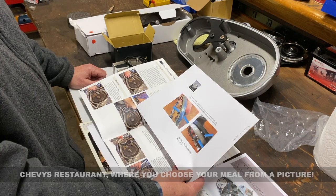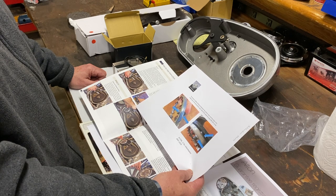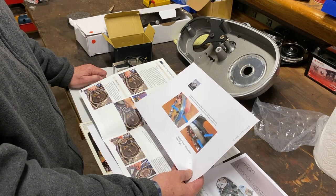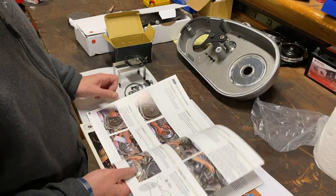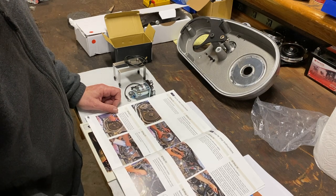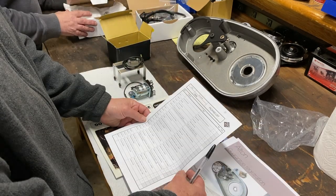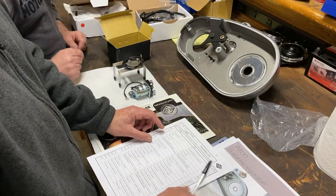There's an addendum — it's about shimming. We've got to make sure we've got clearance between the starter chain and the stator coils, and we may have to fit a washer to ensure clearance. We need to remember to do that. There really isn't too much to worry about electrically, because they've given us the heavy cable. We want to make sure we have a pre-assembled case and sprocket set — check.